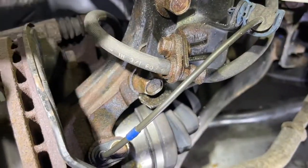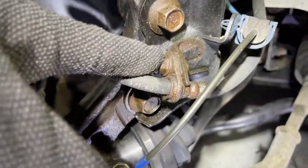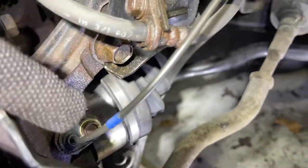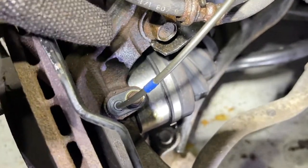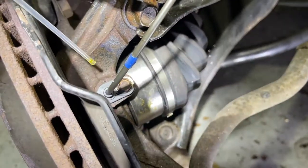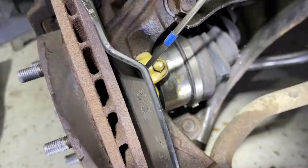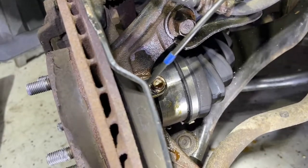We're going to remove this first — just clearing some space so we can move the caliper to the back side. Once we remove the caliper, it's a 12 millimeter bolt, and the sensor is a 10 millimeter. We're going to get those two first and then try to pry that sensor out. Use penetrant on it — some PB Blaster from a couple days ago. I'll use a little bit more now. The customer doesn't have a new ABS sensor, so we're going to try to save that one.